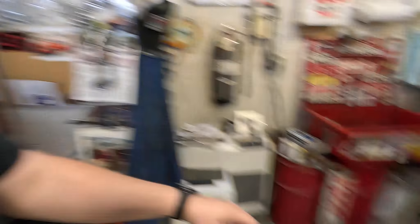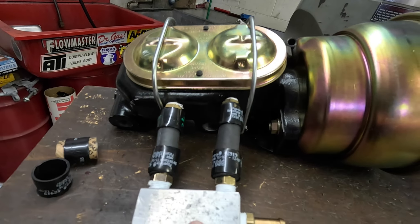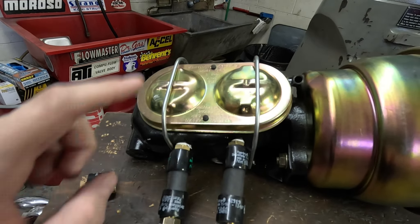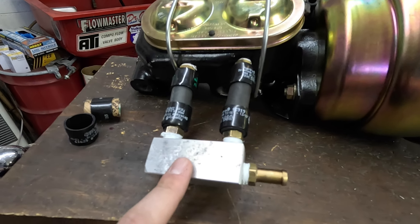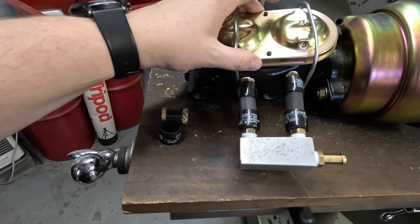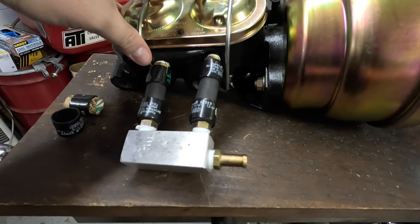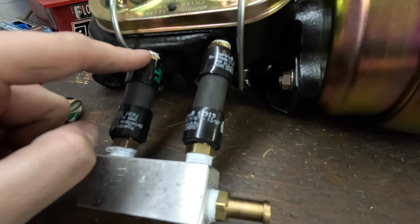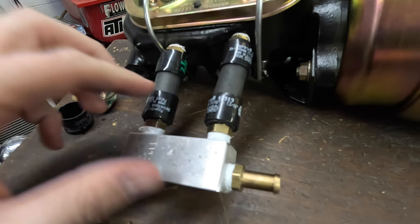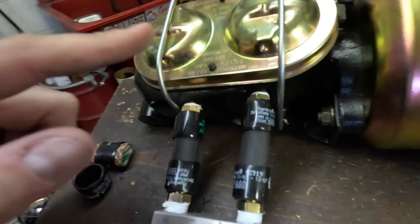It's the next day — we're still working on the radiator. I got the brake booster out yesterday. So this is just a block that's used because we have both ports to go from the front and rear reservoir sections, and this goes into just a block that dad machined with fittings. This hose comes up and forward and goes into the reservoir mounted on the firewall so you can gravity bleed all of this.